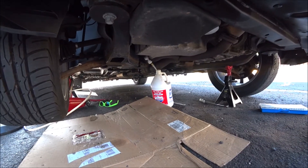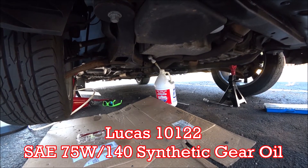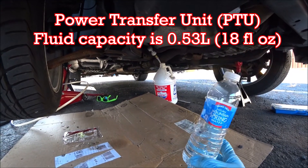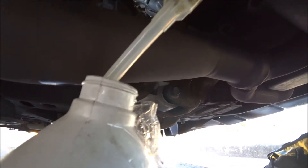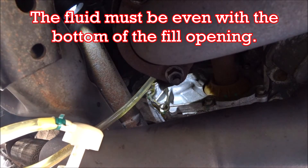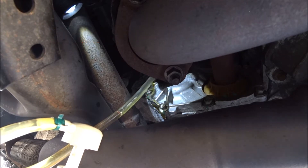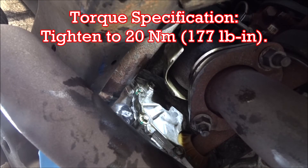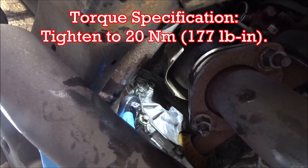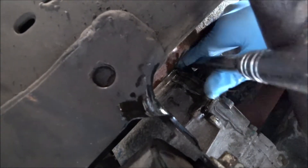We're going to fill the PTU with synthetic SAE 75W-140 gear oil. The fluid capacity is 18 fluid ounces, which is just a little bit more than a water bottle. I'll just pump it until it starts to drip — and as you can see it's dripping — so I'll wait until it stops dripping and then put the drain plug back on and torque it to 20 Newton meters. 20 Newton meters is just a little over hand tight, so no need for a torque wrench. I'll tighten it with the 3/8 ratchet and that should be good to go.